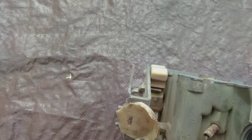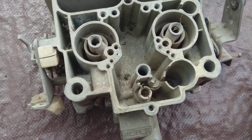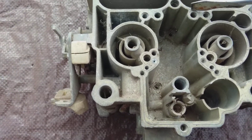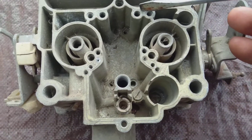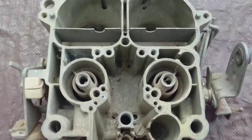And you do that and you've pretty much converted a Q-Jet to E85. There are a few other little things you should do. The air bleeds in the back — they matter. You want to do things to richen the carb, not lean it. So making holes smaller for air bleeds and larger for fuel makes it rich. It's a pretty simple thing.